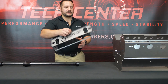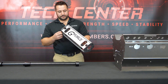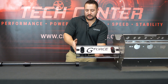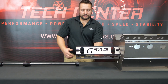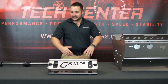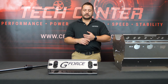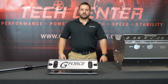That's why we designed this patent-pending cam bearing bore extender. It's a pretty simple design — it bolts to the front of the engine and extends that bore outward so that your cone has something to align on. That way you can pound that last bearing in straight, making the install easy and ensuring those cam bearings go in straight. If you want to learn more about this pro kit, check out our website at crossmembers.com. Thanks for watching.